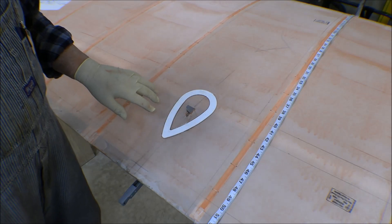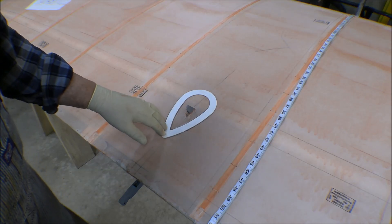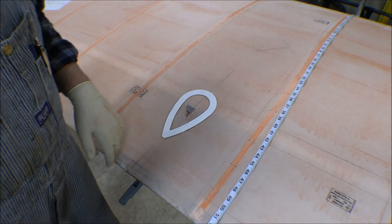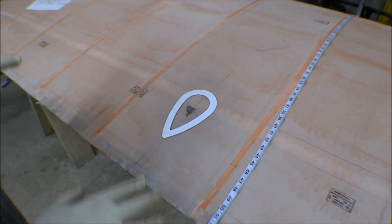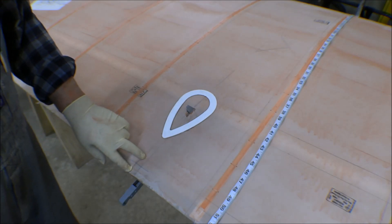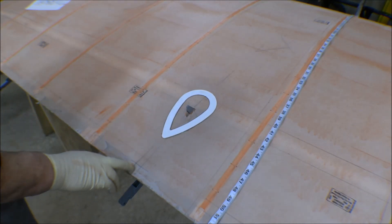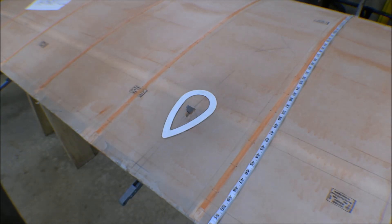Now what I need to do is shrink some fabric down — I think to 250 degrees, I have to check the book — so it's pre-shrunk, then cut out a doily to go over this, going over it at least an inch all the way around. That'll cover the grommet up. This is the only one I have to do on this side; there are a whole bunch to do on the other side. There's one more thing I can do right down here where this turnbuckle beats on the false spar — I need to find something to put in there for a patch to cushion and isolate that, but I think I want that to go over the top of the finishing tape that goes over there. That would probably be a good idea.